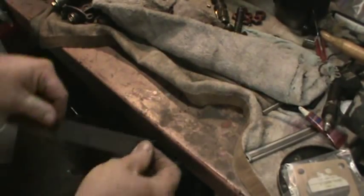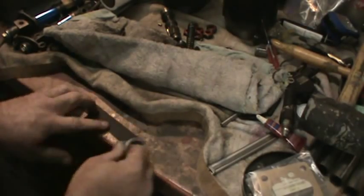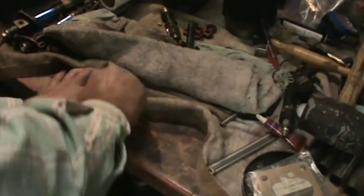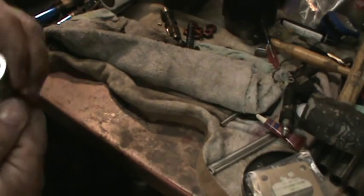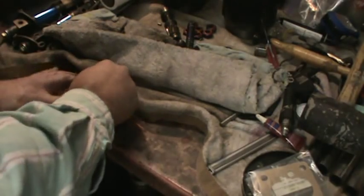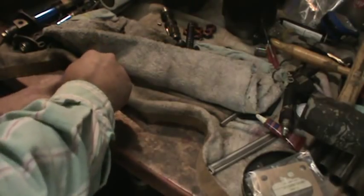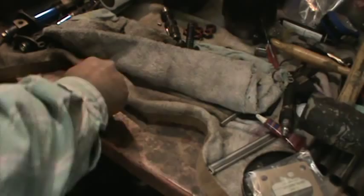My table's pretty flat. This is just for illustration purposes — I won't use this aluminum bearing. We'll just put a piece of sandpaper down. If you had a piece of glass you can use 180, 400, something like that — this is 320. We're just going to sand the thrust surface. You're going to have to sand it quite a bit — you'll be like, wow, is there going to be any bearing left? I've had people ask me that and there's usually enough bearing left. Do both sides — don't just do one side. Try to keep the amount symmetrical from one side to the other. You can measure the bearing before you start with some calipers. You want about four to five thousandths, depending on how much spring pressure you're going to run.